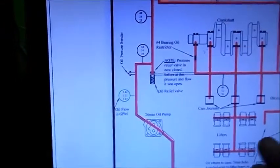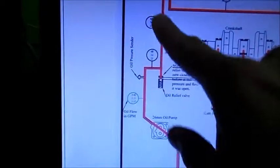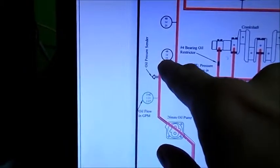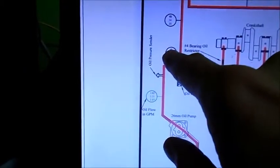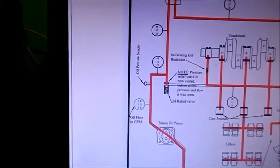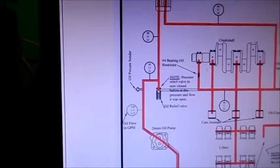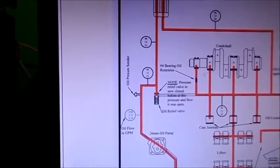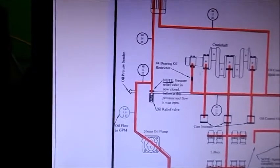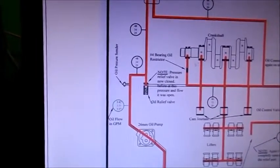This particular system is a warmed up motor at 190 plus degrees. So this is a very warm motor, so the oil is flowing out to the cooler. And they're picking up oil pressures from 25 at the bottom end to a high of 48. If you go back to my motor and look at some of my videos, I'm running, I believe, at about 55 psi at 3200, and I think the Hot VW guys with that CB motor say that they're running at about 45 psi. So in my computations, I'm going to use the 45 psi that they're running at, and 55 or 60 that I'm running at, just for some comparison purposes.